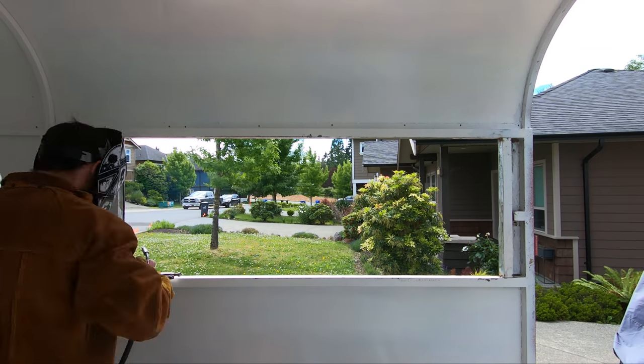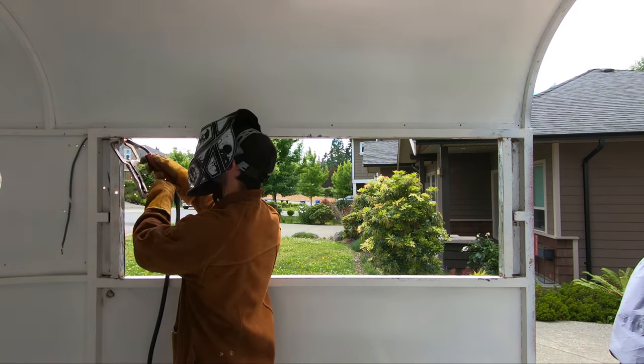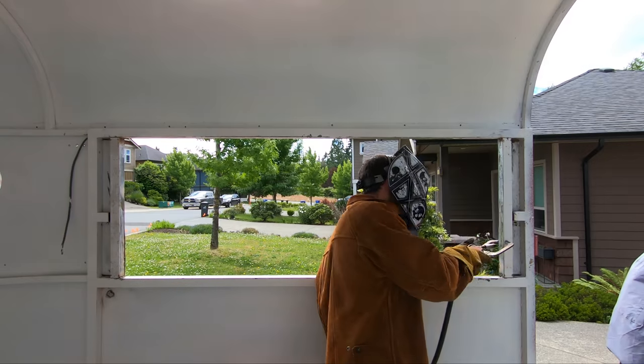This was a long — and I mean long — process. Since I wanted to make this a seamless weld, to avoid warping I made small 1 to 2 inch welds, moving around the frame and allowing things to cool down before warping occurred.